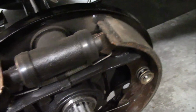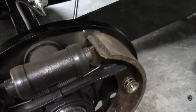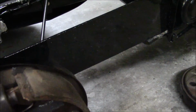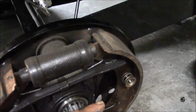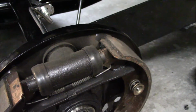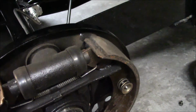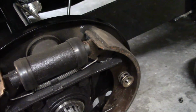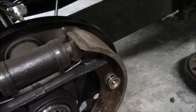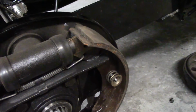If your buggy or Volkswagen was aligned, you want to make sure you get the axle tubes back in the same slot, because the spring plate has slotted holes that allow you to move this forward and rearward to get the correct toe. Many people argue with me, but the correct toe on the rear of a Volkswagen Beetle is 1/8 inch toe out. Toe out is where the front of the rear tires are wider than the rear of the rear tires. It's 1/8 inch toe out.